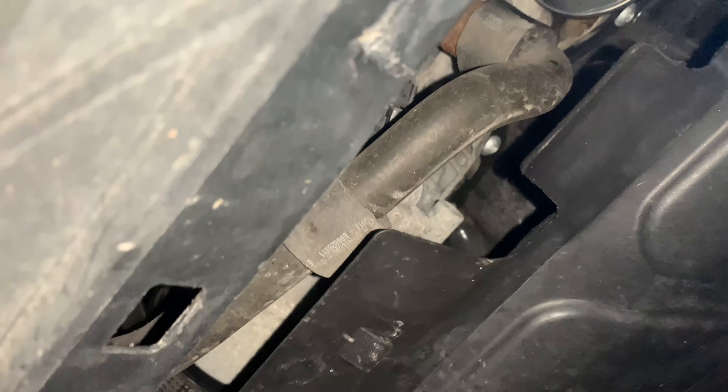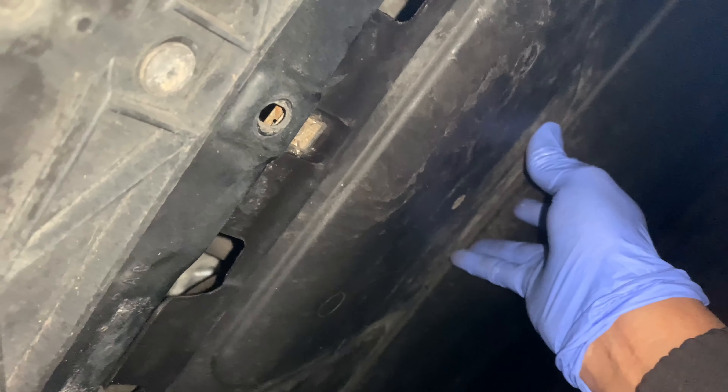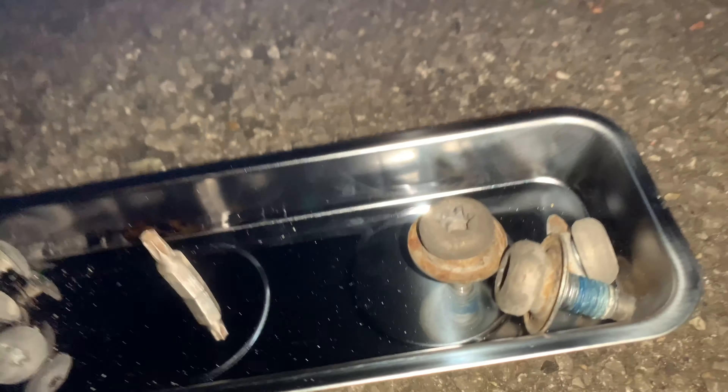So the under tray can now go back on. Just check everything else while you're down here, make sure everything's nice and dry with no leaks. You've got to put the point in first — make sure that clip goes into that hole, and this clip here goes into this hole as well. Those are the only two clips, and then the rest just bolt in. As you can see, that's hooked in and that's hooked in now as well. I'm going to start with the three big bolt torx at the back and then bolt all the rest up. The under tray went on nice and easy.